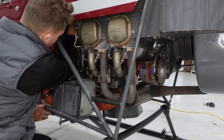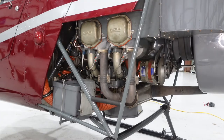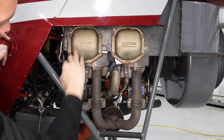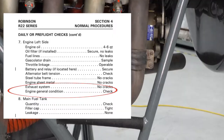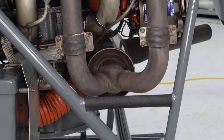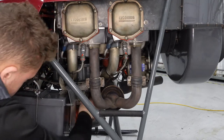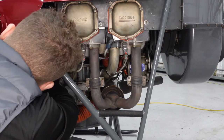Then steel tube frame — anywhere there are welds and attachment points, making sure I don't see anything broken. Then engine sheet metal — running my hands over it, touching, making sure everything feels good. Then exhaust system and engine general condition. This is where I get intimate with the helicopter — touching everything, trying to find problems. This is my final determination of if everything feels good, looks good.